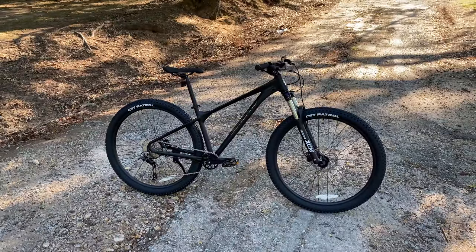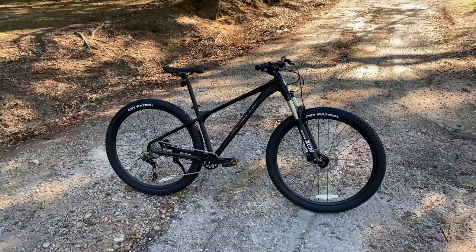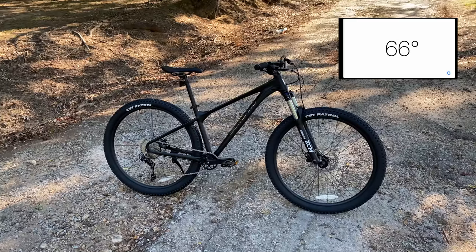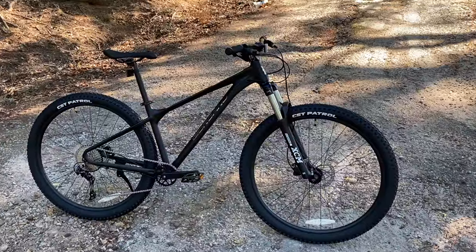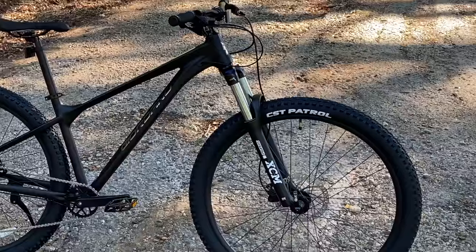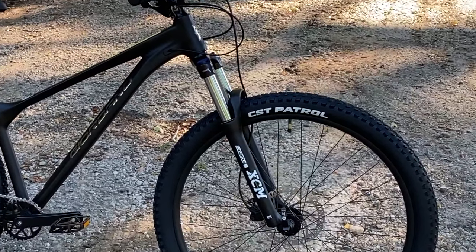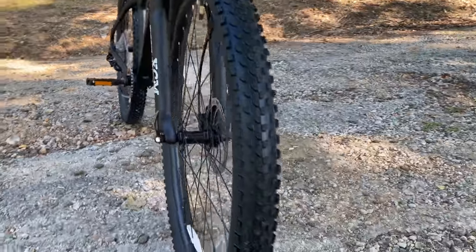This frame is classified as a medium like the other two bikes at 16.25 inches. Kent told me both the Valor and Intrepid have a 67-degree head tube angle, but they suggested I verify it. The Valor measures 67 degrees as stated; however, when I used the same angle finder on the Intrepid I get 66 degrees. This makes me think the bike was initially spec'd with a 100mm fork and at some point upgraded to 120mm, because going from 100 to 120mm on the same frame would slacken the head tube angle by about a degree.